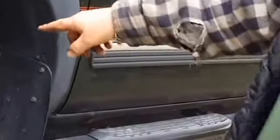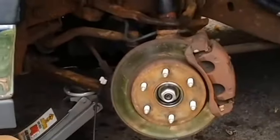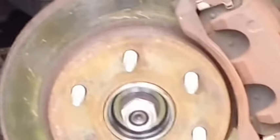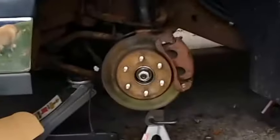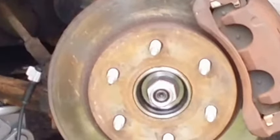Disassembly is a reverse. First take off your spindle nut, drive your CV shaft assembly out so you can get behind there with a socket to get those hub assembly nuts. If you have the opportunity, definitely hit it with PB Blaster or liquid wrench the day before — it makes a big difference. If you have a hard time getting that hub assembly off, don't worry about beating it with a hammer because you're going to replace it anyway. If you wanted to change the CV axle assembly, it would be the same procedure — remove your upper or lower ball joint and drop the knuckle enough to swing it out of the way.